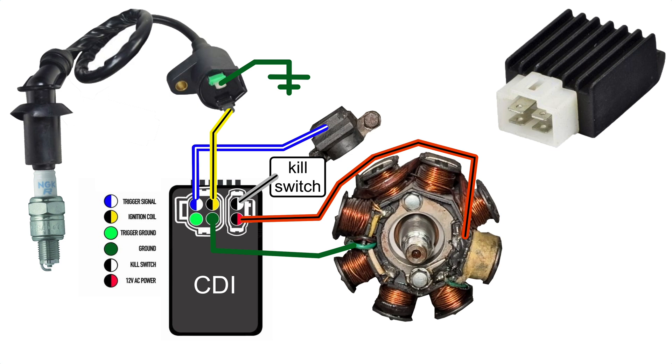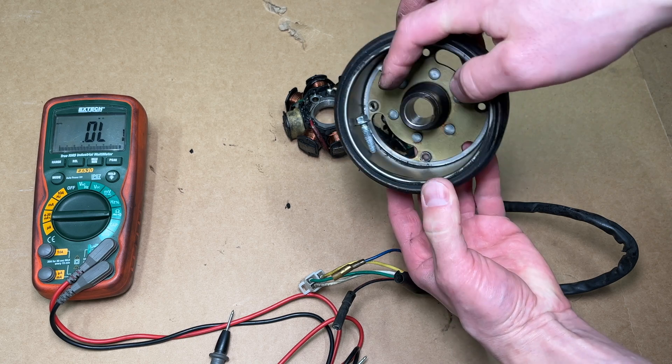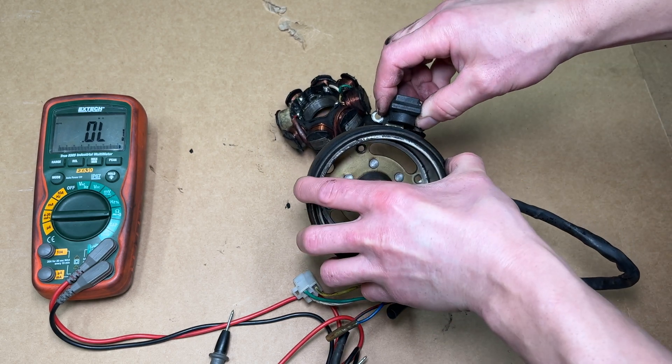If you touch the red and black wire while the engine is running, it will shock you. Some scooters have a DC CDI that is powered by the battery instead. If the coil with the red wire doesn't work, the CDI doesn't get power and the engine won't run. The box that comes with the stator is called the pickup coil and sends a signal to the CDI through the blue and white wire. The flywheel has a bunch of magnets in it. As the magnets pass the coils, electricity is induced into the wires. The metal bump on the outside of the flywheel passes the pickup and tells the CDI when to fire the spark plug.